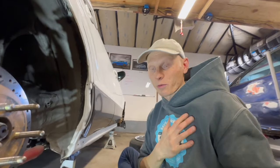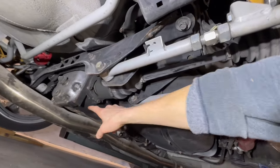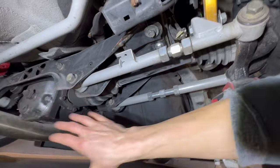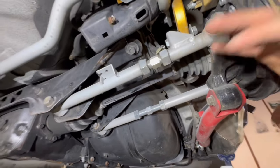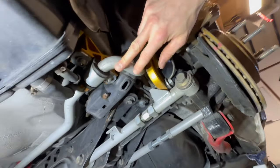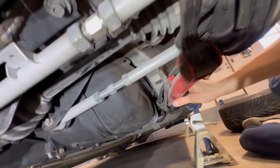I have to say, the one major thing I miss about working at Grimmspeed is having access to a lift. Unfortunately I don't have that anymore — I've just got jack stands — so you're going to have to bear with me as I duck underneath the car. One thing you'll notice is a lot of aftermarket stuff, but before we get to that let me show you the OEM upgrades. The diff is an R180 out of an '04 STI — it basically replaced the R160 in here to handle more power to the rear. I also have the Driveshaft Shop axles I mentioned, rated at 700-plus horsepower, actually meant for drag BRZ applications. Then I've got Whiteline end links, sway bar, sway bar mount, and lateral links back here, plus stiffened bushings on the subframe, subframe reinforcement bolts, and aftermarket trailing arms on either side.